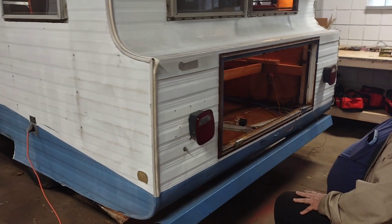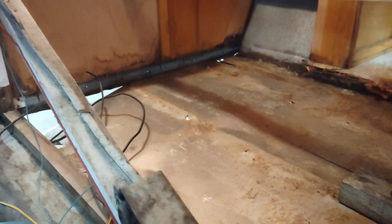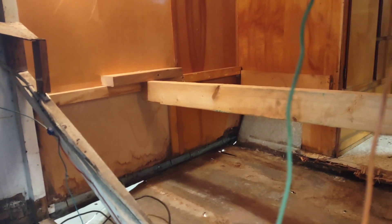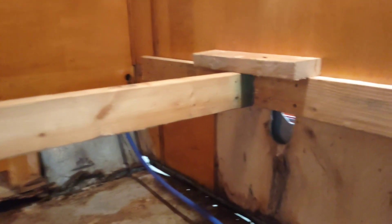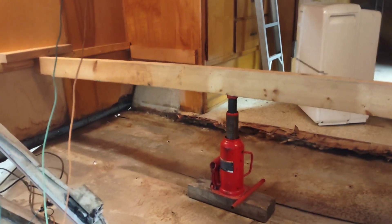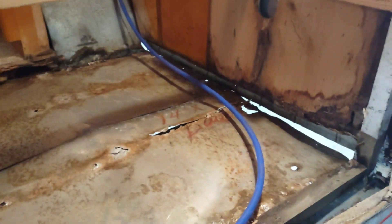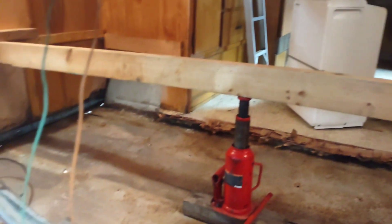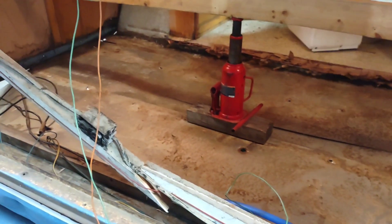Quick update on the 69 Banner — we have dad helping out big time today. So we got the perimeter removed and cleaned up, and you can see this is the proper way to redo a floor: you've got to go underneath those walls. We have a brace here, which is just a couple of two-by-fours screwed in, perpendicular along the walls. One is the base of what was the bed, and I put on a two-by-four screwed into the studs. With a bottle jack we lift up the whole rear of the trailer, taking that weight off the floor that comes underneath the wall. Definitely the hardest part was cutting all that nasty crap out of every nook and cranny down in the corners by the wheel wells. So glad we got that — we're going to take some measurements for framing and get the rebuild process started.